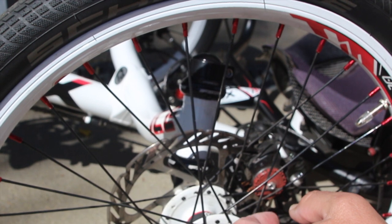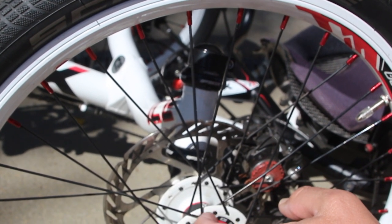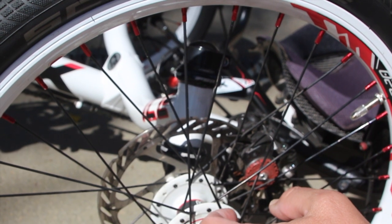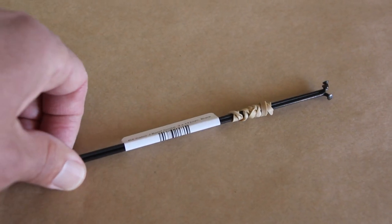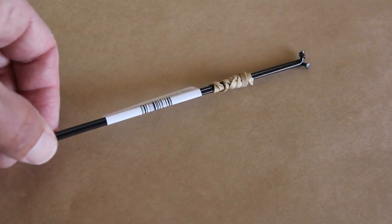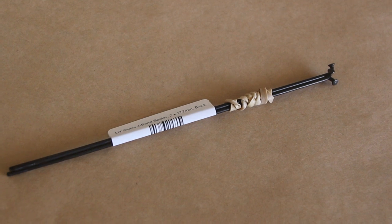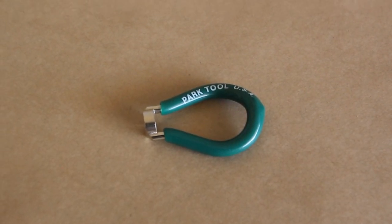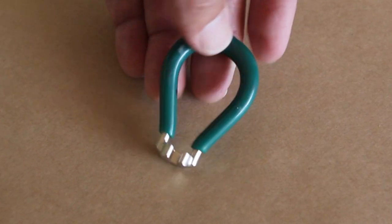The other day I was just riding along when I heard the telltale ping of a busted spoke. I shot an email off to ICE and found out that as a replacement spoke on this 20-inch wheel on my VTX I would need a 172-millimeter spoke. To do this job you will also need a spoke wrench — make sure you have the right size for your spoke nipples.